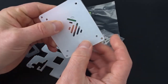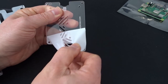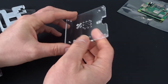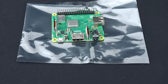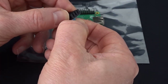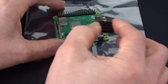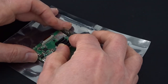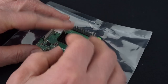I'm going to need to take the plastic film off all the various layers, and I also need to look at the instructions to find out how to put this together — I think this is probably the base. But before I do that, I need to put a heatsink onto the processor of my Raspberry Pi just to make sure it all stays nice and cool in the case. This is attached with thermal tape, so I need to carefully line it up with the processor so it'll fit together nicely when I come to put the case on.